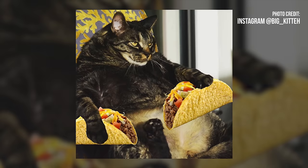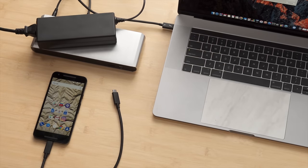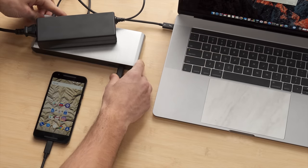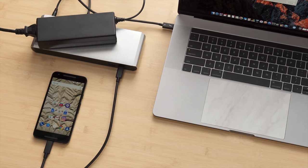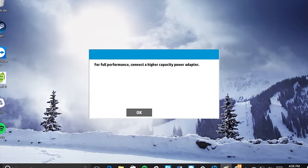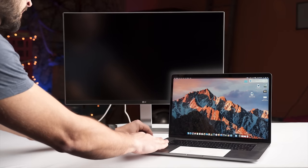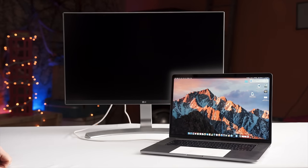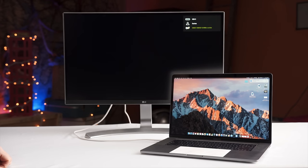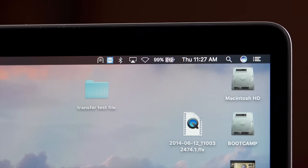Except it's not quite all kitty cats and tacos in this area either. You still have to plug in your wall charger, because even though the TS3 Lite comes with a large power brick, it only pushes 15 watts over the Type-C connector — enough to charge your phone and probably operate your computer, but not enough to charge your computer. This is especially a drag if you have a monitor that charges your MacBook through its USB Type-C port, like LG's Ultrafine 5K or 4K 27UD88, because you'll actually lose that capability if you're running through the dock.